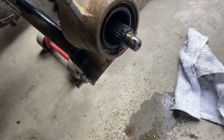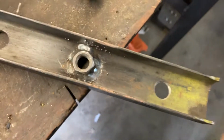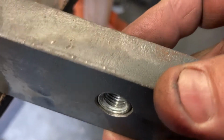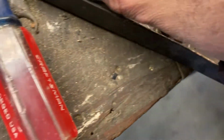In any case, we're gonna go ahead and finish lubing these. All right. I wanted to show you guys with the tool here what I did with the lug nut. As you can see, it's kind of got an acorn look to it. So I made it just barely start in there. If you look at it from this side, it's sitting almost flush. But it does have just enough to start it, so it centers it on both sides.